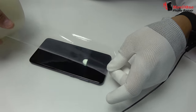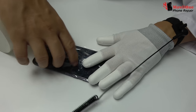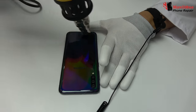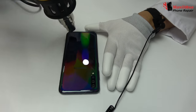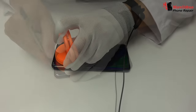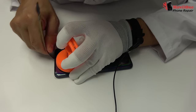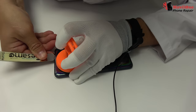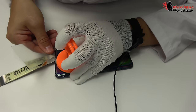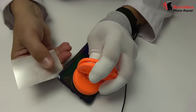We place the plastic protector film. For very little time, we apply heat. Suction cup. Insert metal opening tool. Use the plastic card to loosen the glue adhesive.